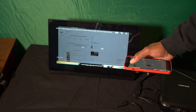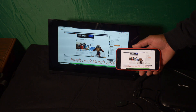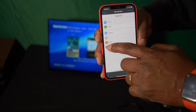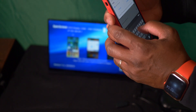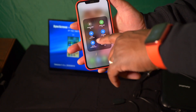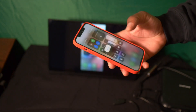That's the first method — connect to the dongle's Wi-Fi, take a picture of the barcode, it opens up the browser and you're in. The other way is to connect your dongle to your home Wi-Fi so you're not using cellular data. Go into the settings, find your network or router, put in the password, and you're good to go. When you cast it now it's going to be AirPlay, and it's no longer using your cellular data — your phone uses your home Wi-Fi. That means less buffering if you're in an area with a weak data signal.